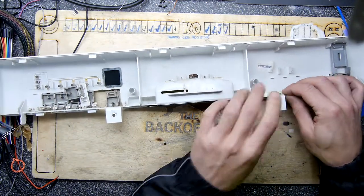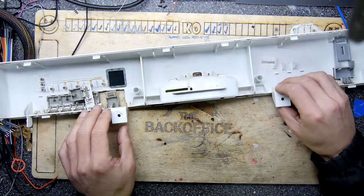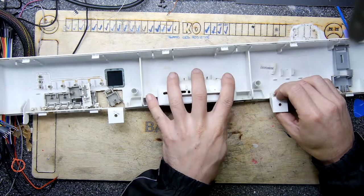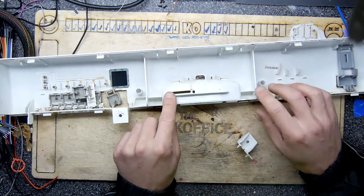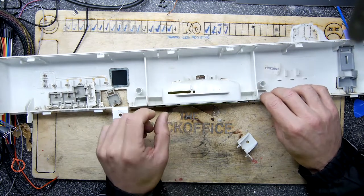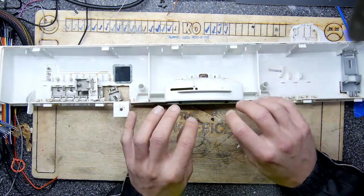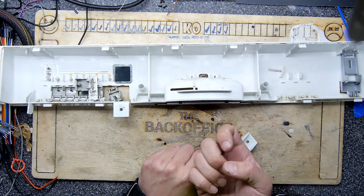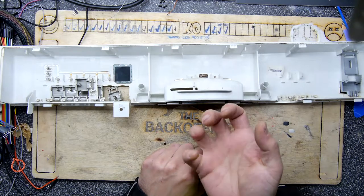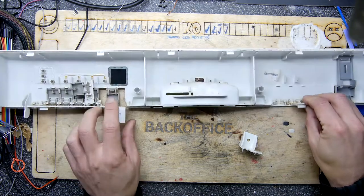Basically, these fascia panels are held on by these two main parts here. They're the two bits that sort of lock in and then support this door handle. And what's really weird is there's a sort of weird child lock system, and you can see there's a bit of it here, and it's just rubbish. And the whole door, once that fails, there's a lot of strain, because when you're pulling the lock, you're not basically activating the unlocking mechanism, you're basically forcing it open. And that puts a lot of strain on these two parts, and then these start to fail.